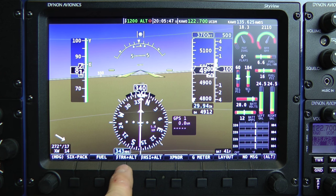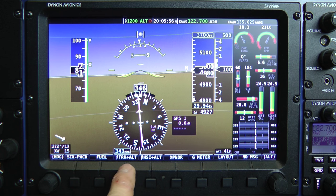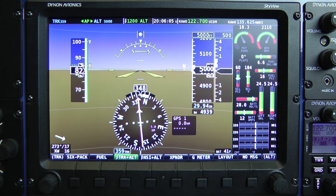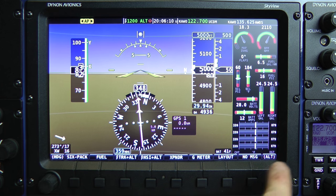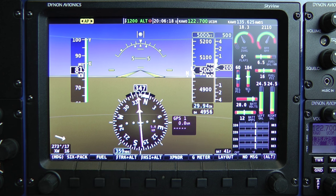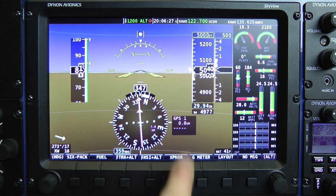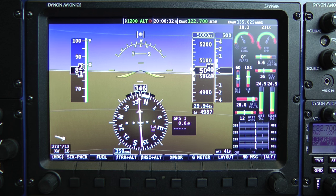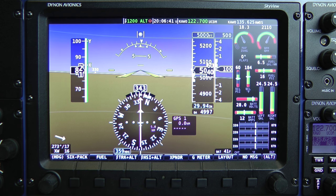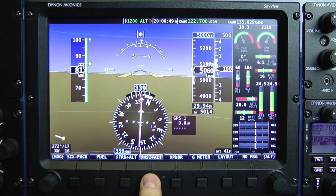Buttons 3 and 4 are the autopilot controls in Skyview SE. We've simplified the autopilot to give you the two functions VFR pilots need. Button 3 is the track plus altitude hold mode — if I were to turn the autopilot on now, it would follow the blue bug on the direction gyro and follow a GPS ground track designated by that bug. The knobs still provide heading and altitude bug controls. Button 4 allows the autopilot to follow a course needle. On the HSI in Skyview SE there is a magenta needle. Skyview SE supports a single external navigation source — a GPS source only, not nav radios, as those are primarily used by IFR pilots. If you own a VFR GPS navigator that outputs standard NMEA format as a serial output, you can connect that source to Skyview SE, and button 4 would have the autopilot follow that needle while maintaining your altitude.